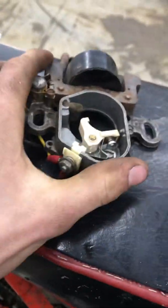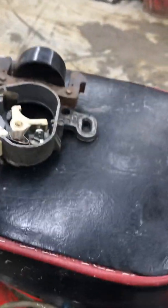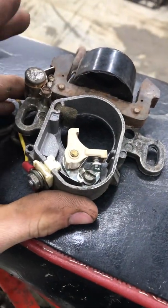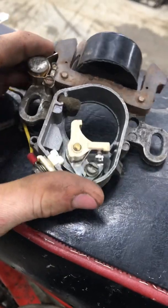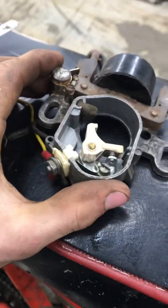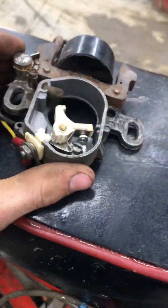You can see it's got slots in there where you can rotate a little bit. A Briggs & Stratton or a Kohler — they only have breaker points set like that so they're much easier to set just to get them running. But a Tecumseh is a lot nicer for a high performance application like racing or pulling, because you can advance the timing through the coil a lot easier than a Briggs & Stratton or a Kohler.